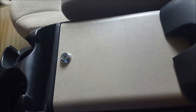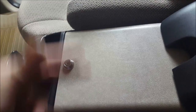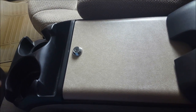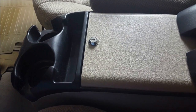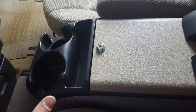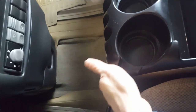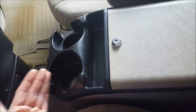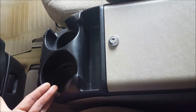I had an arc in the enclosure to let sound waves travel side to side. The flaw I noticed is that the thing sounds amazing up front — very bassy up front — but because the back of the front face is flush with the floor, the sound waves have a hard time traveling to the rear of the vehicle. It still sounds good for rear passengers, but it's not nearly as bassy. If I were to do this again I'd raise the whole thing to allow sound waves to travel, since subwoofer frequencies are omnidirectional. Also, I created flanges so the enclosure is secured to the floor — this thing doesn't move. Always secure your enclosures so they don't become a projectile in an accident.